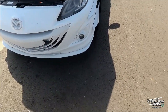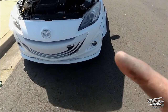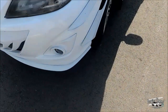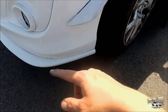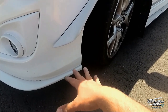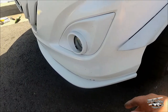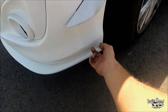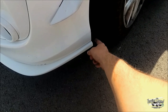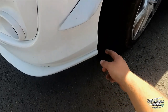Alright, well it's back on. If you guys are wondering what lip this is, this is actually the STI lip — I think it's a 2005-2006 STI lip. One question I get asked the most is whether you have to modify it to make it fit. You actually do, but it's not really a big modification. Just line it up like I did. The only modification you're going to need is cutting the ends — it'll be about an inch on both sides too long. I use pipe cutters to cut the ends.